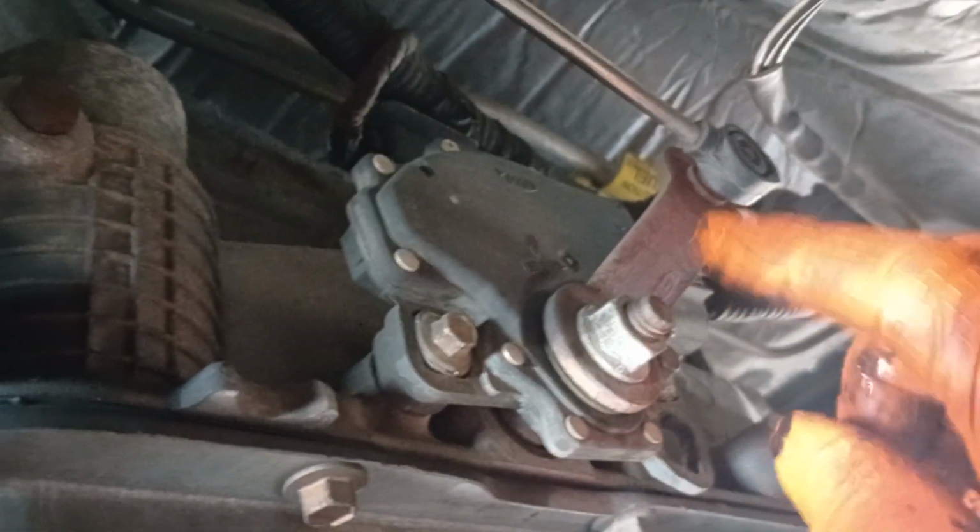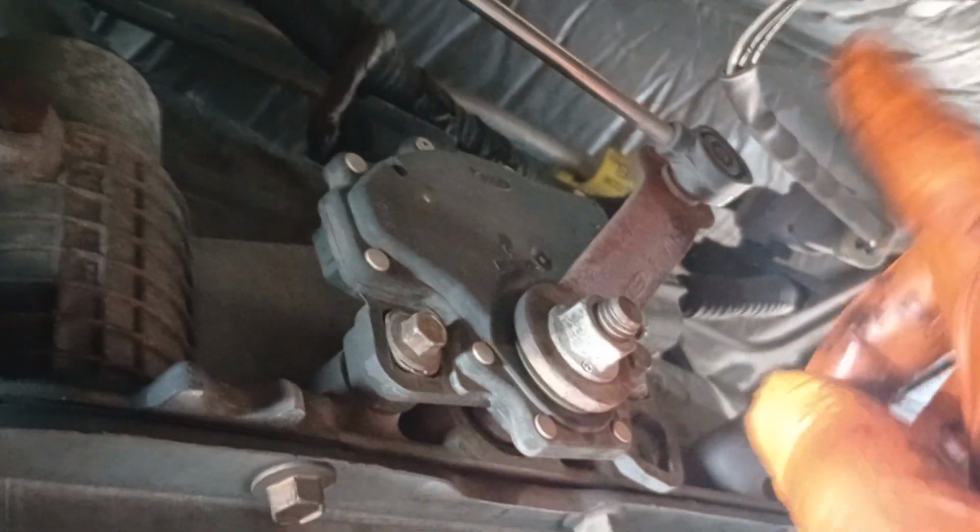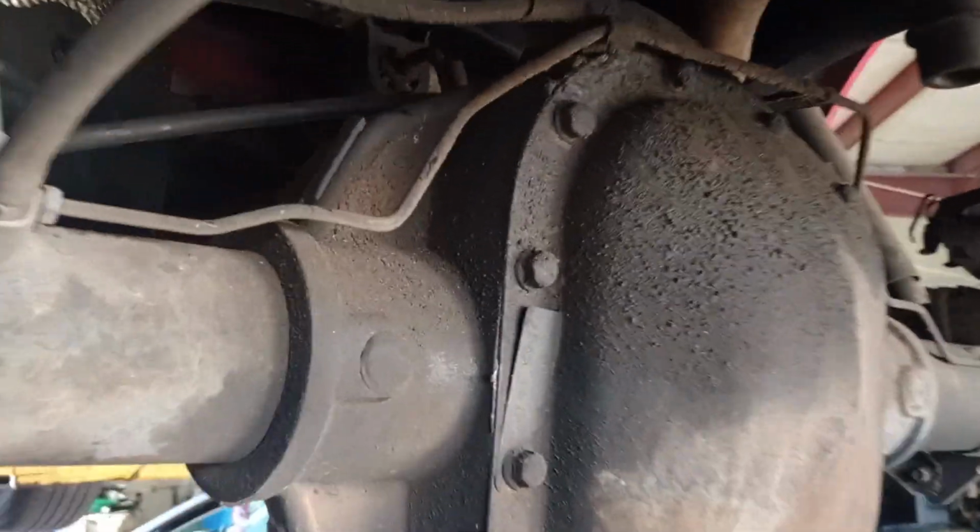The next thing is to ensure that your drive shaft will rotate. You can do that by coming up here, and you can pop your shift linkage cable off from right here. Get a flat blade screwdriver up under there, and it'll pop this off. That way you can put this indicator into neutral so you can roll the drive shaft, because you'll have to do that once we get into this differential.